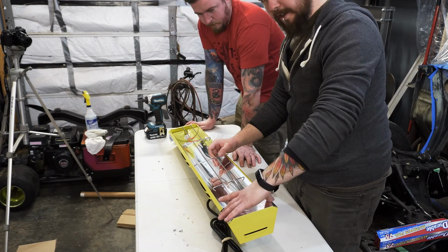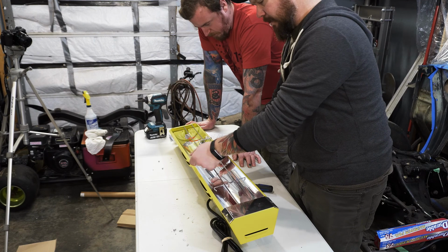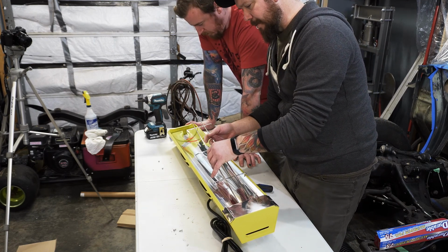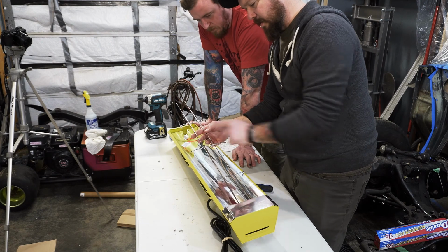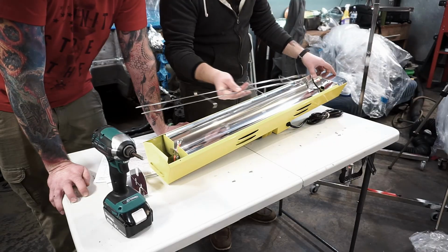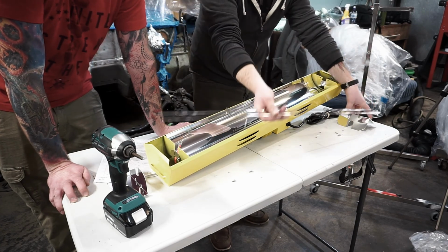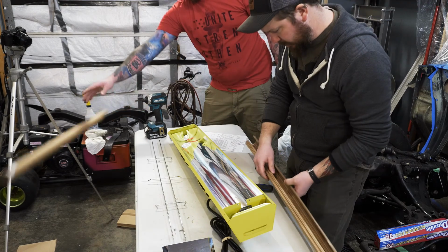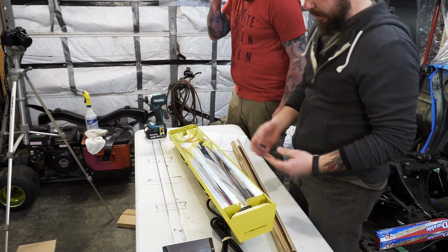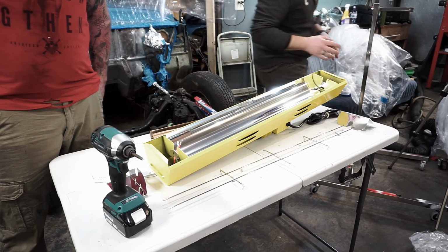Basically, you loosen up these ends here, and then move the grill. It actually has little holes here in the center, so you pop it out of those little holes. That's where these go. And then you slide the whole thing one direction, and then it allows the ends to come off at the same time that the grill comes off. For real. I'm gonna go ahead and put on some gloves because I'm gonna guess that getting oils from your hands on the element is a big no-no.